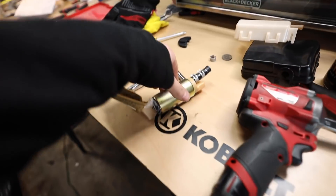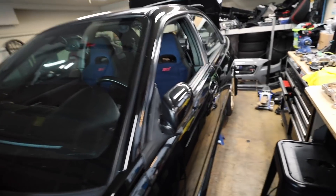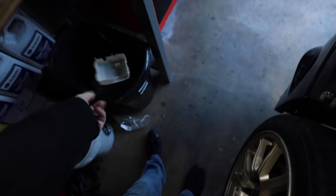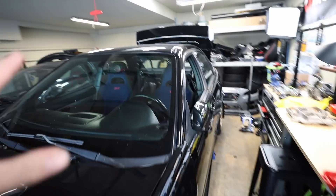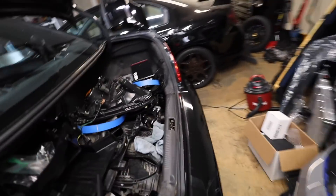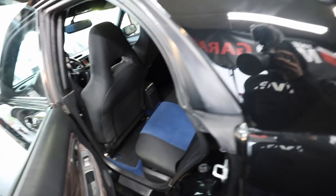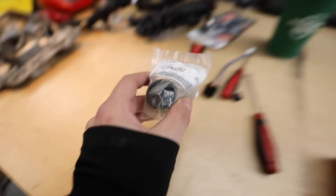The new fuel pump is in the car, but pulling out that OEM fuel pump only furthers my confusion — why do we have a semi-built motor with a stock fuel pump? We now have a Walbro 255 in there. I'm just trying to clear out as many parts as I can. I'm going to order that fuel pump panel cover tonight. Then we'll get the new boost controller thrown in — it's just a Cobb 3-port. Back seat is back in and looking good.